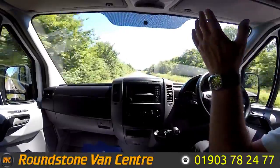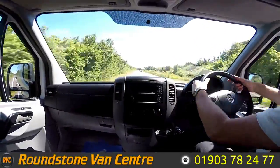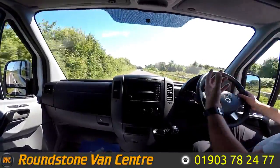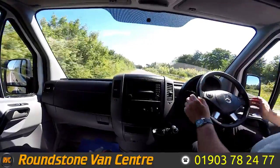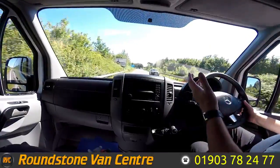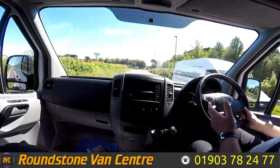Now if I take my hands off the steering wheel you can see it's sitting in an absolutely straight line. I'm going to give the steering wheel a shake — it's really nice to steer on these. Now I'll approach the roundabout and demonstrate the brakes. Braking now — taking my hands off the steering wheel — there we go, as you can see there's no juddering and no pulling. And that's the final part of the video appraisal and road test of the Mercedes Sprinter 313 long-wheelbase panel van.